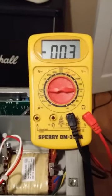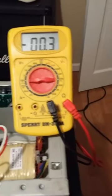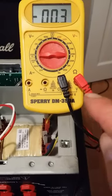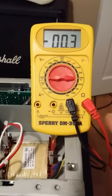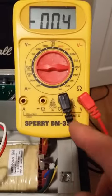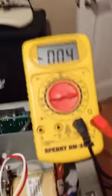After you get that all set — and like I said you can only do one side at a time — when you adjust this, that's for one set of tubes; this side's for the other set of tubes, and the middle is the ground. You come over here now to the meter. Make sure you set your meter right — a lot of guys don't set it right. You want it right here on 200, and that's obviously millivolts. Make sure that the wires are correct. A lot of guys don't put them correct and they can't get the reading right. You have to make sure your positive is on one side and your negative is on the other side — the common says negative, and the V on my meter says positive.